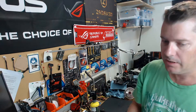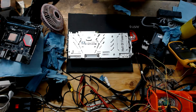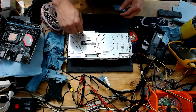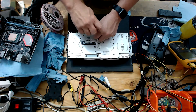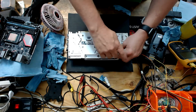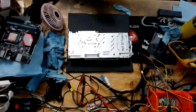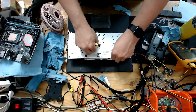It's really straightforward. The first thing we've got to do is identify which screws to take out, then carefully unscrew everything and keep everything for safekeeping. The reason why we are stripping this card down is because we're going to be using it cooled by liquid nitrogen. So obviously we have to remove all the stock heat sinks and fans. We've got to insulate it for moisture control and then slip on the GPU pots.